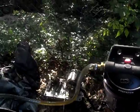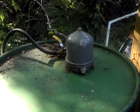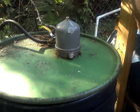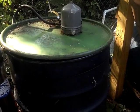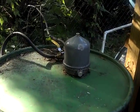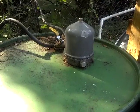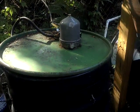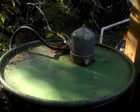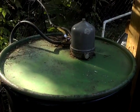The pump doesn't draw much power at all. It's a 55–60 gallon-an-hour centrifuge and I let it run for four cycles. Since I started using the pre-filter, there hasn't been much gunk inside the centrifuge, but it does get a lot of the grease and fats out. You don't want to heat your oil too hot because it'll melt the fats, and that causes a lot of problems. I keep it around 100 degrees — gets out a lot of the black nasty stuff that would otherwise be stuck in your engine. Anyway, I hope you like it — leave comments if you care.